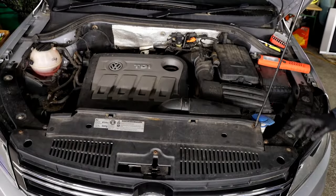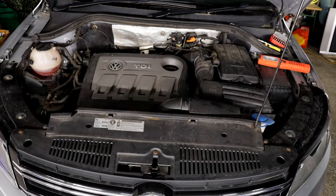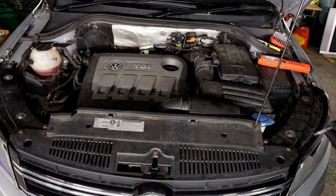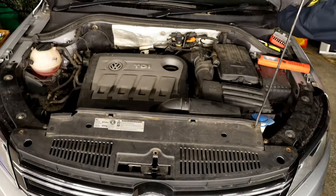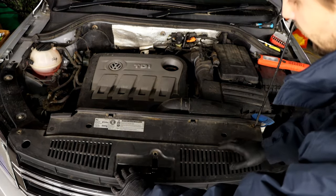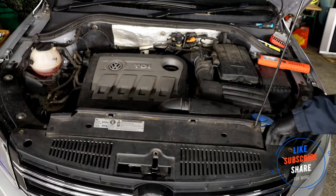The first thing will be to remove three screws holding the front grille in — Torx 25. You'll see that removing them makes more room to get your headlight out of there. That's them done, and you're going to see that the grille just slides out. Don't forget when you're refitting it to slide it back under there.